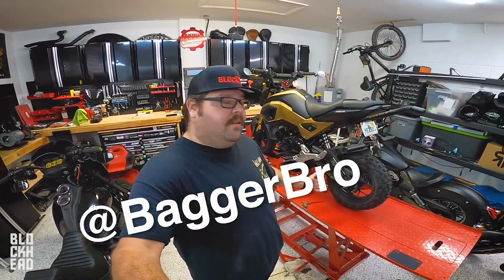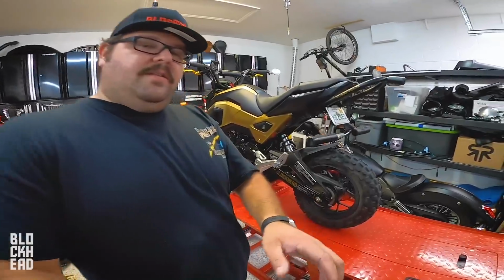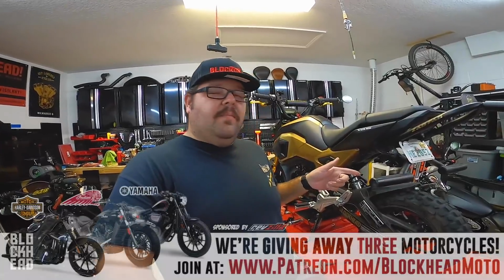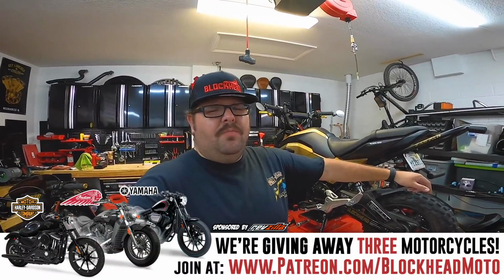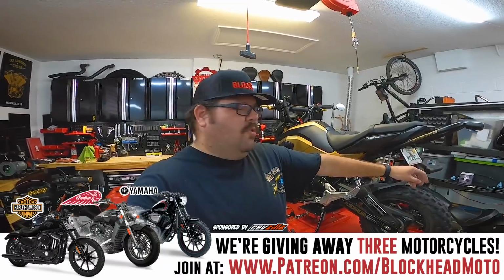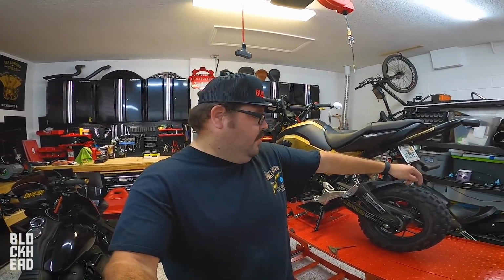We're gonna put a new chain on Block's favorite motorcycle, his Grom. Get rid of these cheesy chain adjusters. He bought new brake pads, but I was looking at them and they're super meaty, so there's no reason to change the brake pads. So we're gonna take the caliper off, clean the rotor and brake pads and the caliper up with some brake cleaner, and then slap it back together. And hopefully that'll get rid of his squeaky sound he's getting.